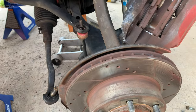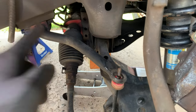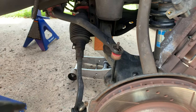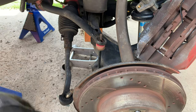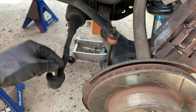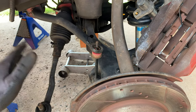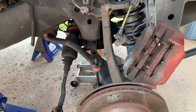Here's a good example of an inner ball joint that's not broken or failed but not so tight — lift it up and you can see the play. That's one of the reasons I want to change the inner, and I'm gonna go with factory Toyota parts. It's not worth it to buy aftermarket, save some money, and have the thing fail in a couple years. With factory stuff, hopefully I won't have to worry about it for another 10 to 20 years — and these are original from '98, so it's been over 20 years.